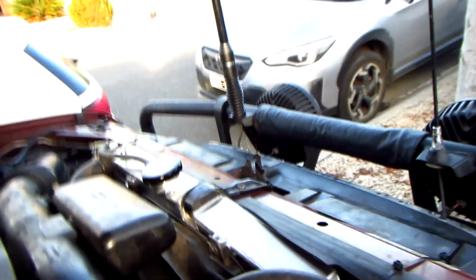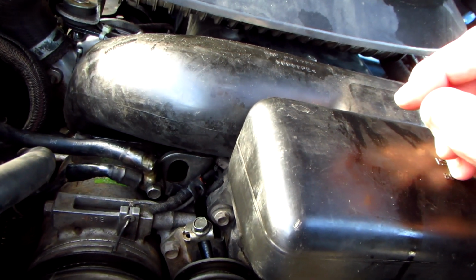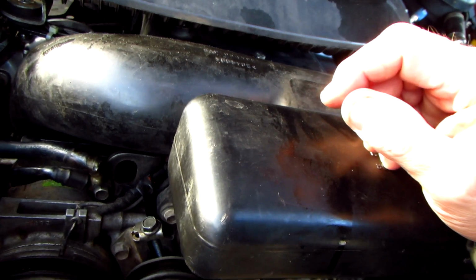Now, I know that the engine isn't hydrolocked with coolant because the coolant level's still the same, so it's not that. We thought the idler pulley for the aircon was stuck, but that's not it either. So today I'm going to remove this and back off the alternator, then we'll see if the water pump seized. If that's not seized, then it's going to be a new engine job, I reckon, but anyway, we'll see how it goes.